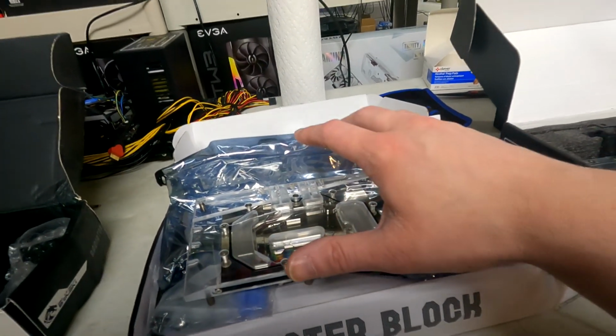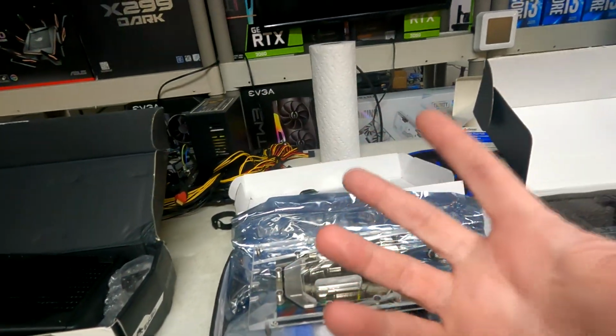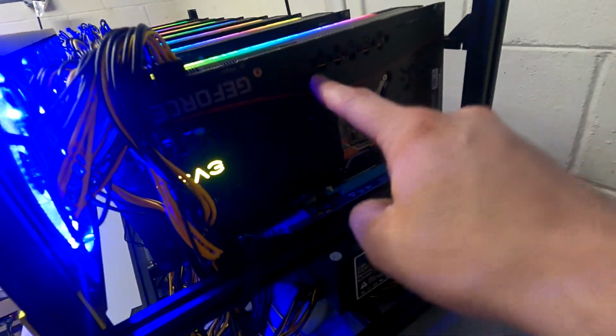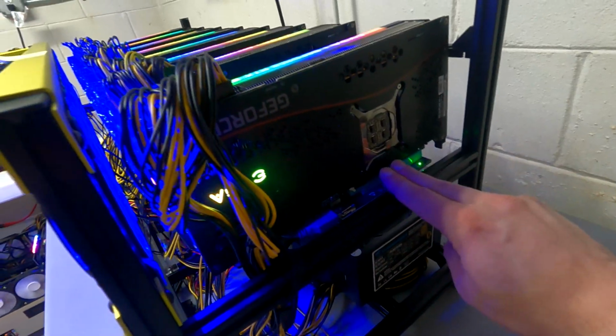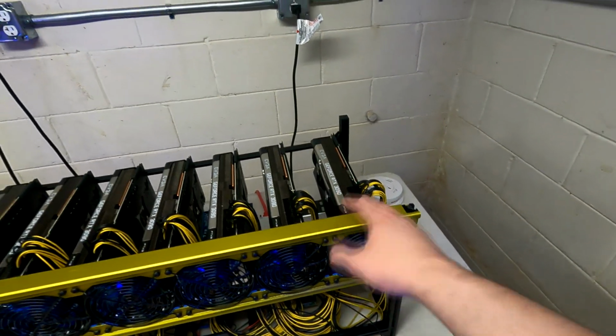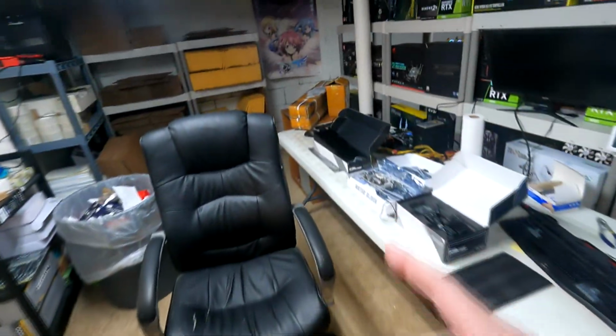But the 3090s are a little bit more unique because there is memory on the rear of the card. And here's the thing, it feels like a fatal flaw of the 3090s, all right? So if you go back here, these are 3080s, right? There's no memory anywhere around this. Now, I got thermal pads in there that I've done because you can still draw heat out of it, and it really, really helps. But there's no actual chips on the back. But the same thing with the 3090, and you can't see it because it's covered, but there is memory around here. You gotta remember, the 3080s have like 10 gigabytes or whatever, whereas these have 24 gigabytes, so you gotta put them somewhere, right? And on the rear is where they put it, but they don't put anything to go with it. There's no active cooling. That's where the water blocks come in. Now they'll be actively cooled and cooled very, very well.